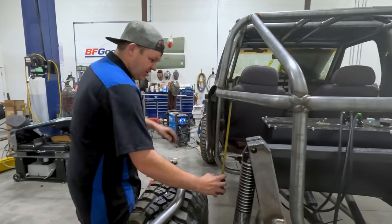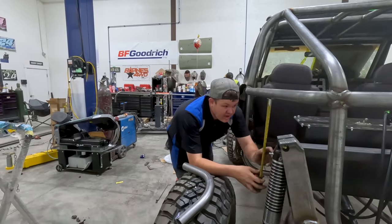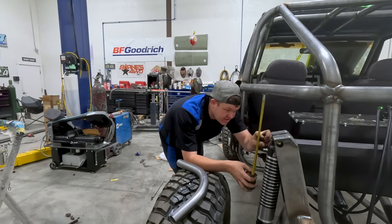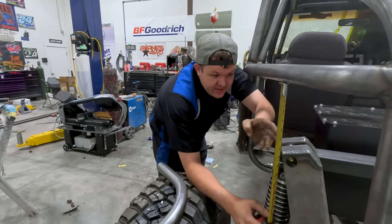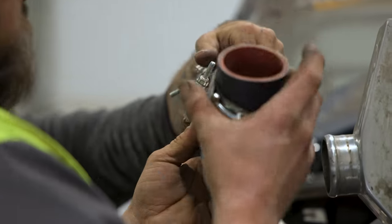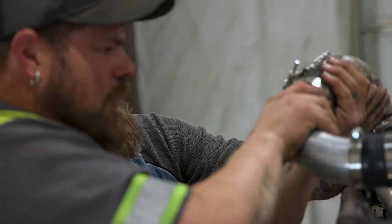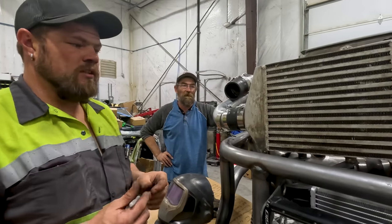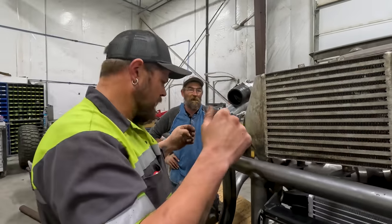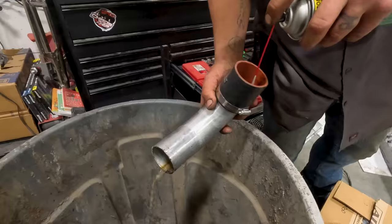So I think what I'm gonna do is right off, oh, I can't. Because if I put a bar down 8 inches, it's gonna be right here in the strut zone. Okay, so we're gonna go 7 inches because that's gonna come right past the strut tower. Gotta trim this pipe down a little bit because we've narrowed the whole engine bay up a little bit. So now we gotta trim this down so it will actually clear and not have hoses and stuff on a bind. Cleaning all this, the oil out, throwing all the metal things out too.